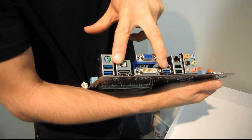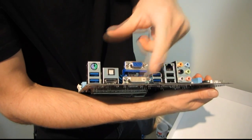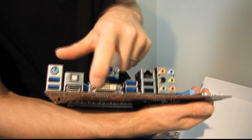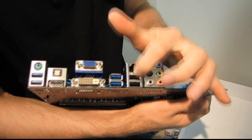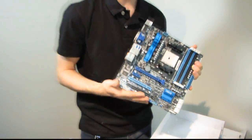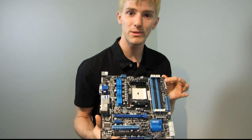On the back panel, we've got four USB 3 ports, one PS/2 mouse/keyboard combo port, optical audio out, HDMI, VGA, and DVI. Notable is that the DVI port supports up to 2560x1600 dual link — very cool, and I haven't seen that on onboard graphics before. There are also two USB 2 ports, a gigabit ethernet port, and 7.1 audio out. Thanks for checking out my unboxing of the F1A75M Pro from ASUS. Don't forget to subscribe to Linus Tech Tips for more unboxings, reviews, and computer videos.